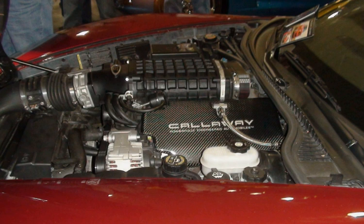In 2005, the Generation 3 was superseded by the Generation IV. This category of engines has provisions for high-displacement ranges up to 7,441 cc (7.4L, 454.1 cu in) and power output to 776 bhp (579 kW). Based on the Generation 3 design, Generation IV was designed with displacement on demand in mind, a technology that allows every other cylinder in the firing order to be deactivated. It can also accommodate variable valve timing. A 3-valves-per-cylinder design was originally slated for the LS7, but the idea was shelved owing to design complexities when the same two-valve configuration proved sufficient.